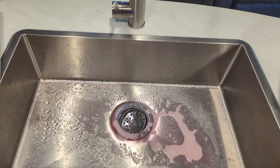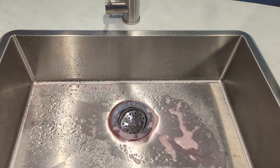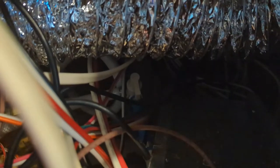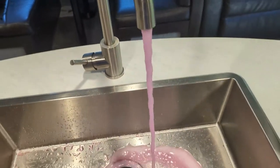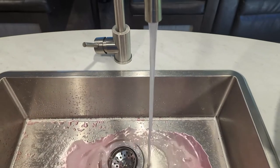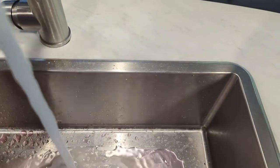The reason it was taking so long was I still had my water pump in bypass mode. I've got a three-way outlet on mine — there's a tube right here which is where I suck in antifreeze in the winter. That white little valve in the back — I still had it in bypass mode, so it would have been trying to suck out of that tube. So make sure you double-check that switch is in the right position so it's drawing from the fresh water tank. Now that it's set correctly, we've got good flow.